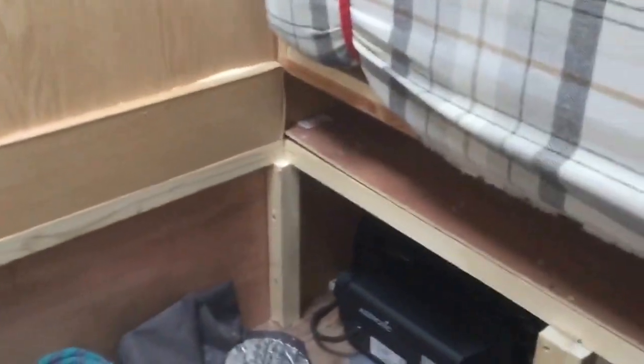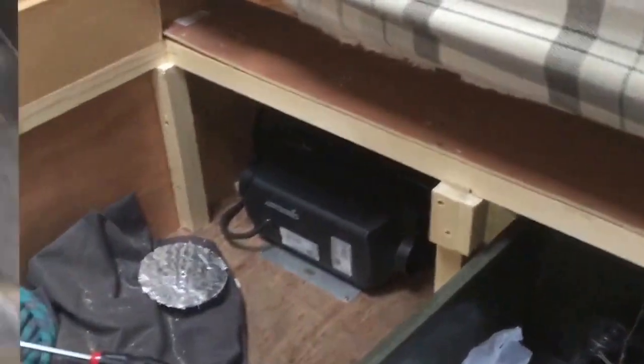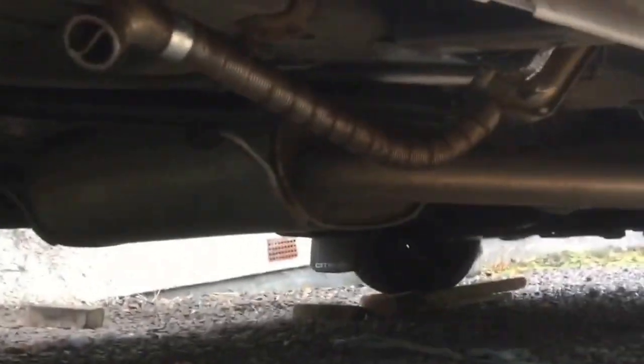So I'm going to leave it to get hot, just check over the exhaust system, make sure that nothing's setting on fire or melting, and check that flash banding I've put round. I've just come outside the van — you can hear the clicking. Coming round to the exhaust side, you can really hear the unit. I have shortened the pipe slightly here from what I had on before, so it may be a little bit noisier than expected from my last van, but it definitely won't give me any issue at all.